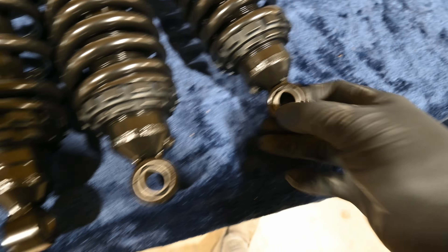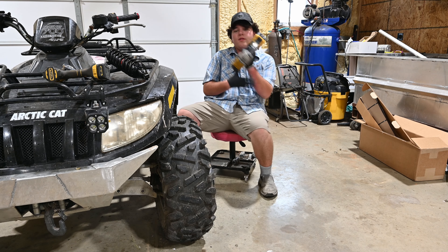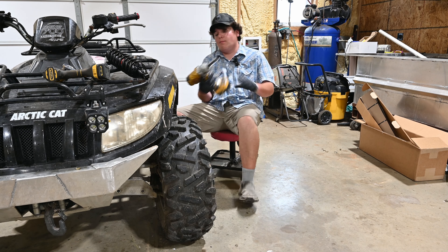As you can see, brand new bushings in there — pretty epic. First thing you're going to need is a 17mm. To get the shock off you need a 17 and I believe a 13 or 10 — pretty sure it's a 13. On the front bottom it's a 17 and a 13; on the back bottom it's a 10, and a 17 and 13 on top.